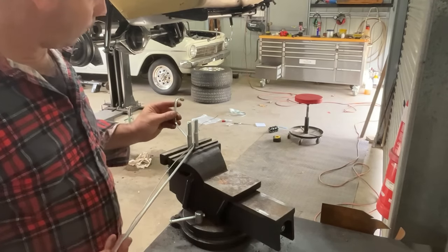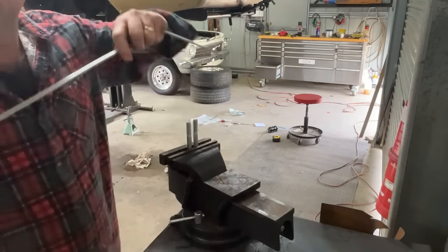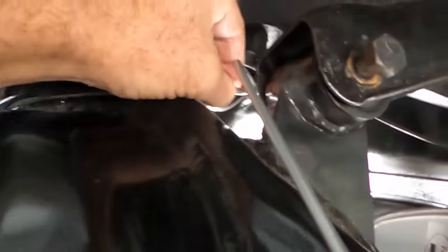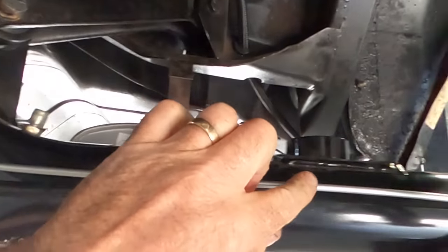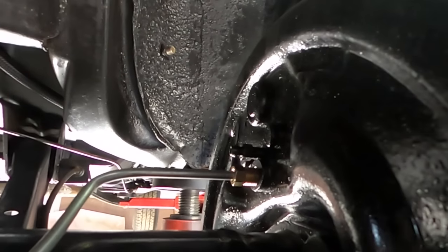So far, so good. So we'll check how that's going in the car. And so when you're going back into your splitter block, whatever you want to call it, make sure you can go in just with your fingers. Leave everything loose and just go in with your fingers. Because there's going to be tension on the line and here, make sure you can just wriggle everything.